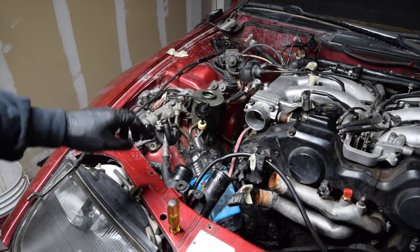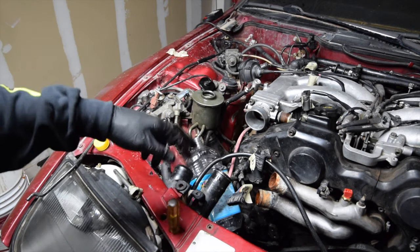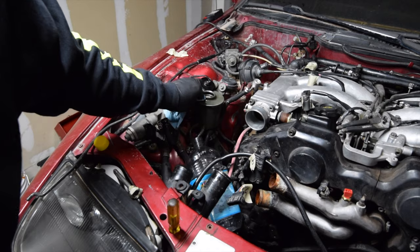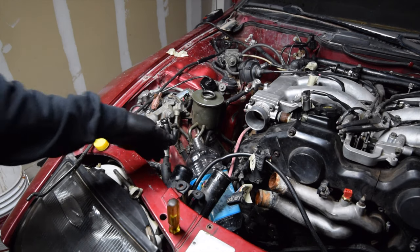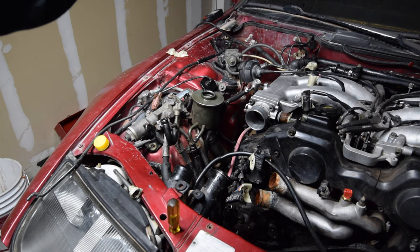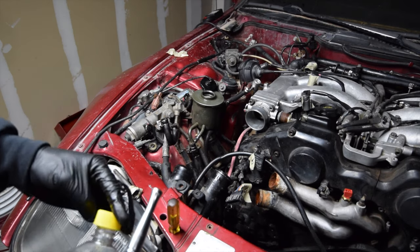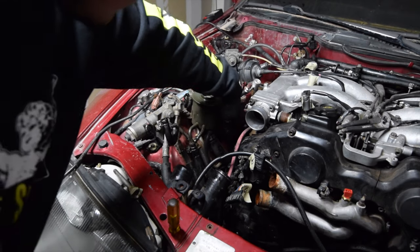The whole reason I'm doing this is to drain the power steering. The power steering pump is going to come out along with the hose, so I didn't want it draining all over the car. There wasn't that much power steering fluid in the reservoir and the color looks good — not dirty or anything. I don't know the last time it was flushed, but there's very little mess, which reassures me not a whole lot will fall out when I pull that power steering pump. I'm going to disconnect this hose right here.